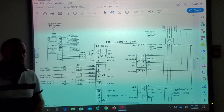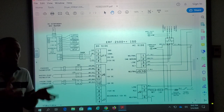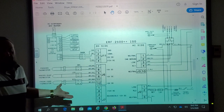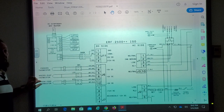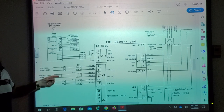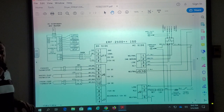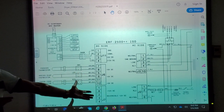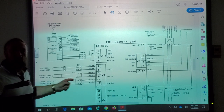So you can have the voltage and your board is still bad? Yes — the board's program could be bad, or how it reads that thermistor may not be correct. If you've got the proper resistance reading of that component, that component's not bad. To verify, test it against the other thermistors. They may be interchangeable, and if checked at room temperature and they all read the same — and you're getting that reading from the plug — it can't be the sensor, it has to be the board. Two ways to test: one, test voltage; two, check continuity or resistance.